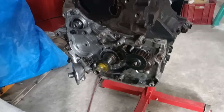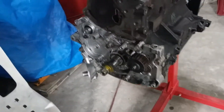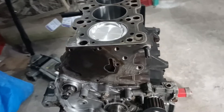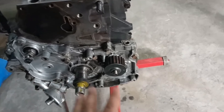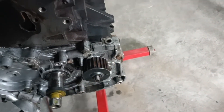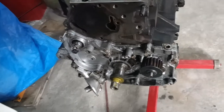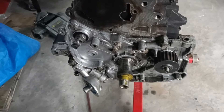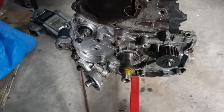This is the oil pump for the Sonata — the EVO4 one doesn't work. The major difference between the oil pump casing from the EVO4 versus the Sonata is this part right here; the flange on that part is very, very different. Apparently they made a lot of casting changes in Korea to suit whatever it is they wanted to make it work for.